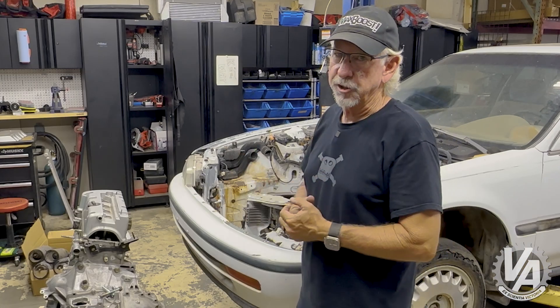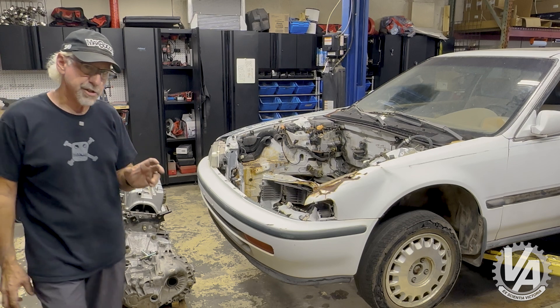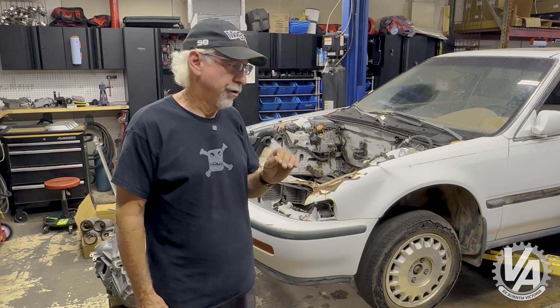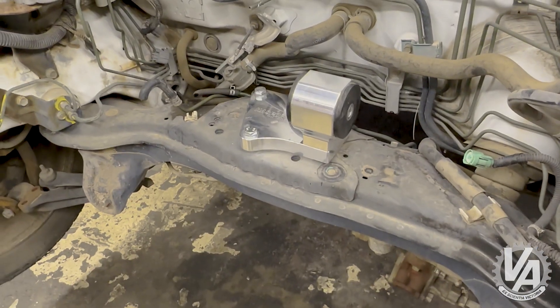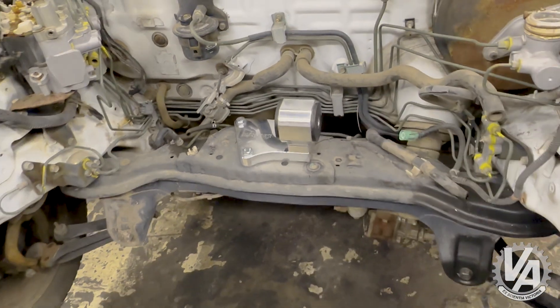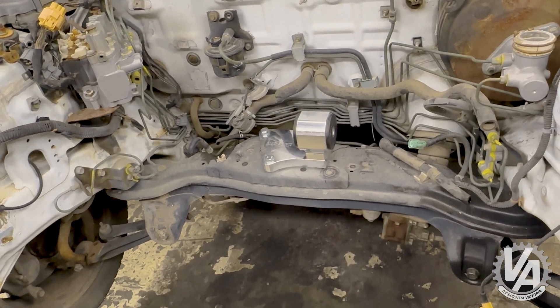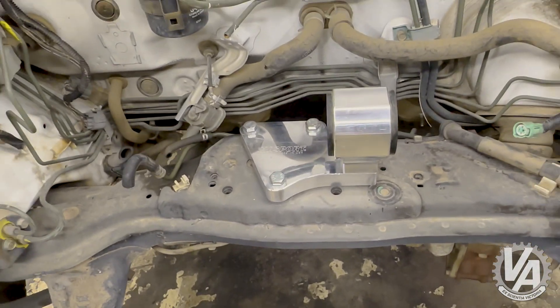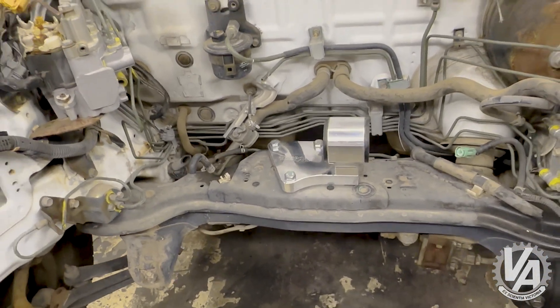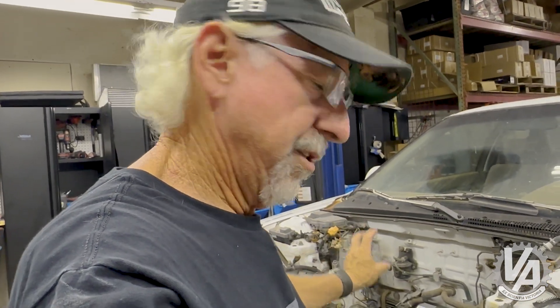So what I'm doing here today: got an engine, got a car, I'm going to put them all together and get this working. First thing up is the position or location of the engine. The way it's going to work is we're going to use our Prelude rear mount and bracket in order to locate the engine in the engine bay. This is the rear mount used on the Prelude and the CD Accord — it just so happens that the three bolt holes this mount uses are common on the 90 through 2002 Accord as well as the last two generations of Prelude.